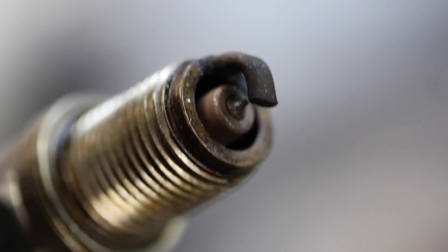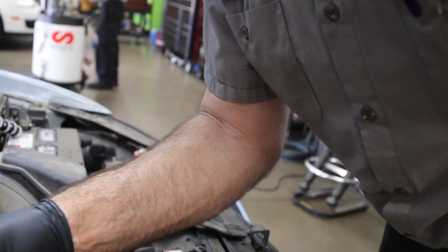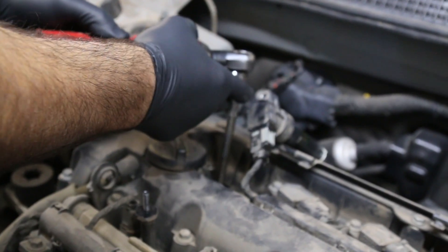With a cylinder one misfire, the easiest thing you can do is pull the spark plug — we'll immediately be able to tell at the tip of that electrode what is happening inside the combustion chamber. With us dumping a lot of fuel, we anticipate that electrode is going to be full of fuel. Getting a spark plug out on this four-cylinder motor is not very difficult; on some V6s and V8s the rear bank plugs can be more challenging.